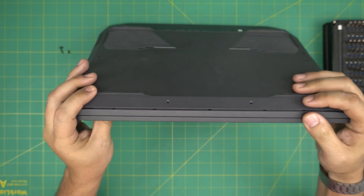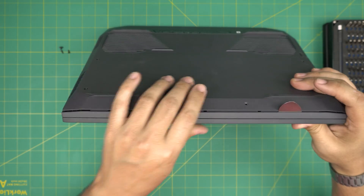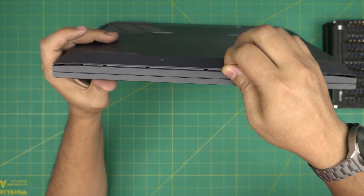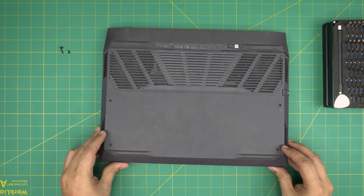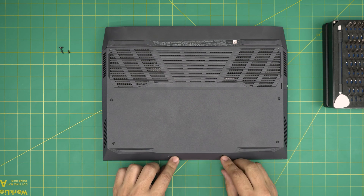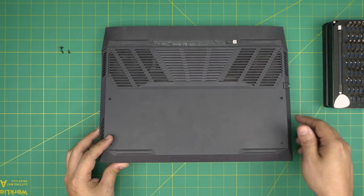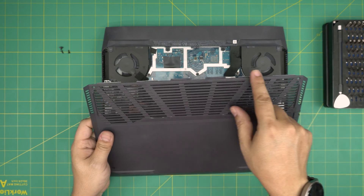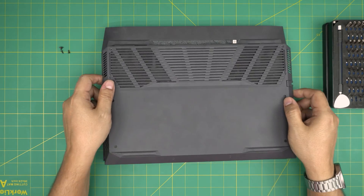In my case it just came out, but sometimes it gets really tough. If it doesn't come out, stick the guitar pick in there and twist it really hard — you'll hear some click sounds as the clips release. Once those clips are released, grab it from the front corners, wiggle around, bring it up at a 45-degree angle, and pull it towards yourself. At the back end there are tiny hinges that scoop right under the back plastic, so don't lift from the back side or you'll damage the plastic.